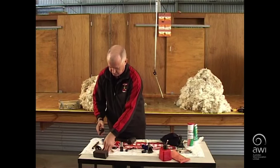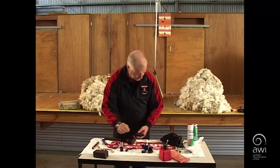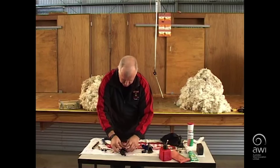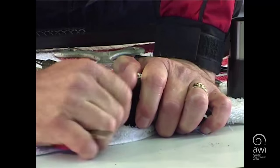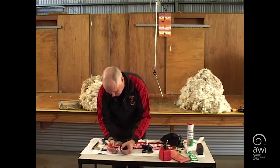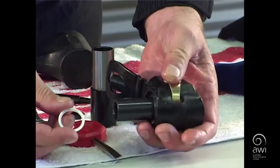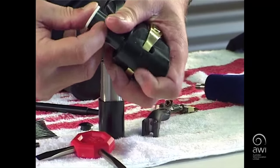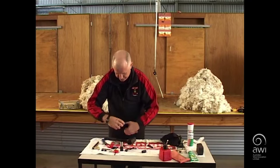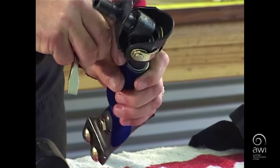Put the cover with the tongue over the outer back half joint. With new grease in the caps, put the back half joint together. The seal must go into the inner back half joint the correct way — the side with the two lips goes to the cogs. Slide it halfway up the back joint half, then slide the joint into the barrel and press the seal home. Once the seal is home, push the joint right into the barrel and put the cog on.